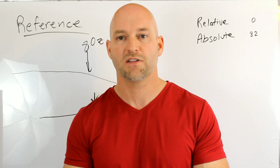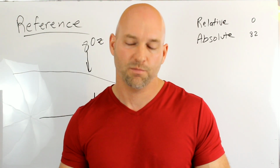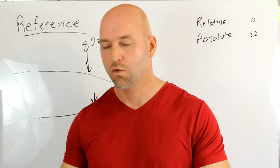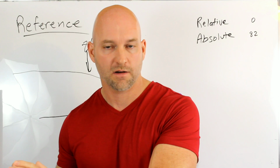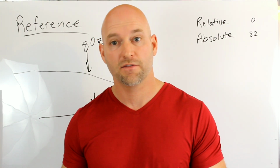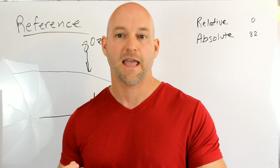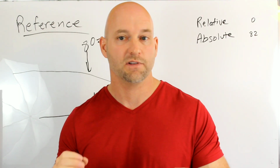There's nothing wrong with that, because you want studios to always record at the same level, but it doesn't always happen. It's just the way it is, so we just deal with it. But one thing you will notice, from forums and things like that, when people discuss how loud they listen on their calibrated systems, most people are going to be around -15 to -20. We talked about this when we went over how much amplifier power you need in your system. It's going to be heavily dependent on your listening levels.